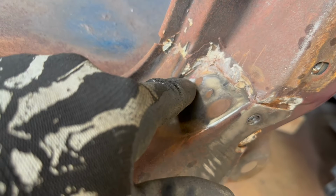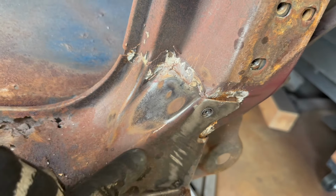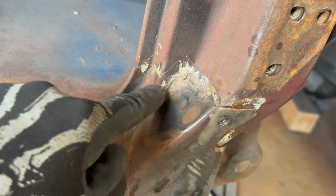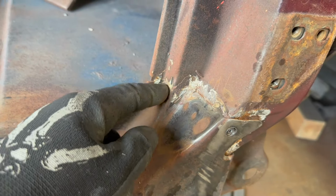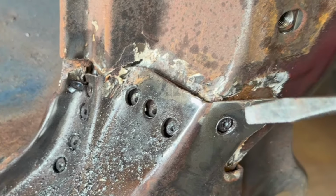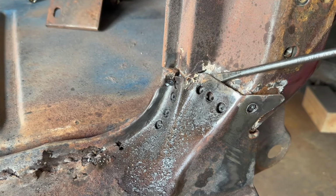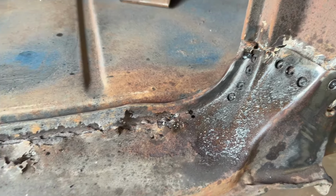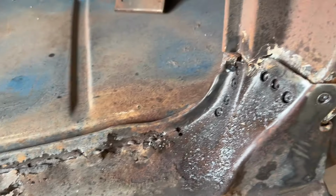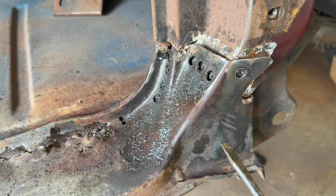So that kind of helps you identify where the welds are. It's not perfect, but the rust stays because it's sunk in a little bit. Oh, feels like there's one there too. So this is what I'm doing. Just find your little welds and drill it out. And then you get this. And you just go until it comes off. That's about it. So I think this is where I'm going to call it because it feels like bourbon 30.